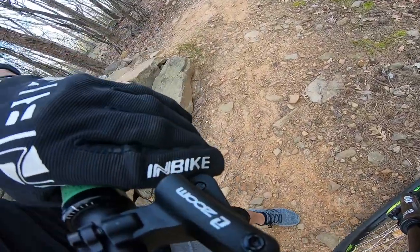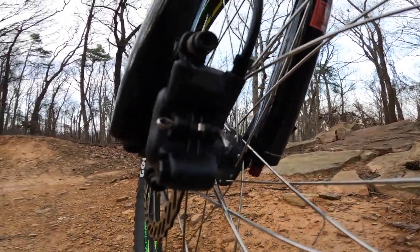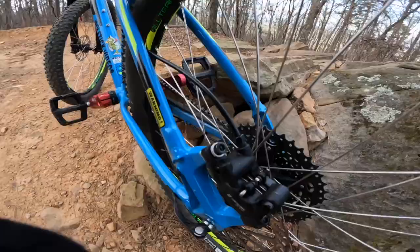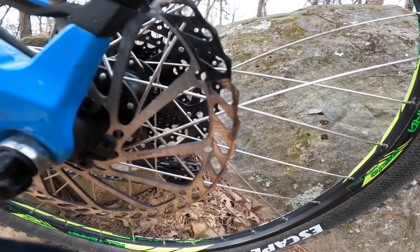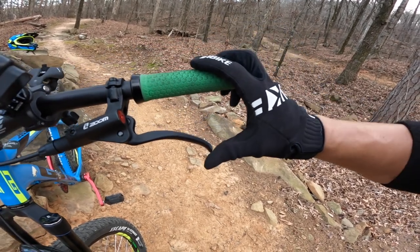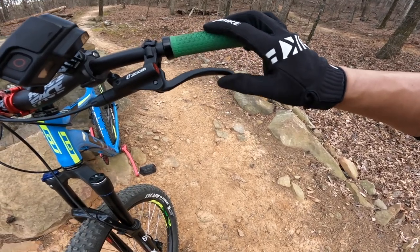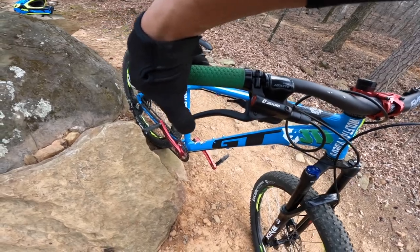Let's take a look at these brakes. I can feel the pads making contact with the rotors, but it doesn't feel like they're getting an extremely big amount of grab — not like the 420 pads, which get a really good grab and you can feel the entire thing making contact. It's just not wanting to really stop me. Both top and bottom pistons are working simultaneously. On the rear one, there's a little bit of discoloration up towards the top — that discoloration was not there previously with the MT420s. The lack of feel and feedback from the brakes is another issue. Earlier the lever was engaging about out here, and now we're squeezing all the way back — there is some sponginess. And on the rear, we have the exact same problem — even more so.